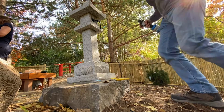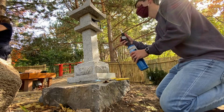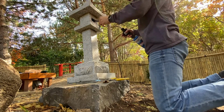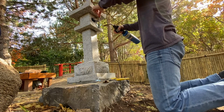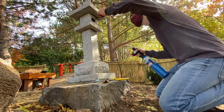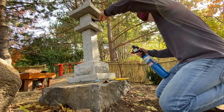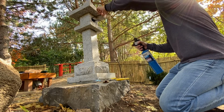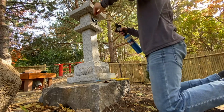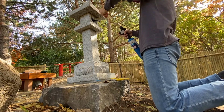So after crimping them down, then I grabbed the portable blowtorch essentially, and I heated up the splices so that they shrunk and essentially melted onto the wire and created a waterproof seal so that the copper doesn't get exposed to water. And it was super easy, worked really well.